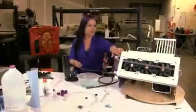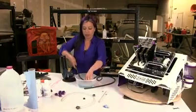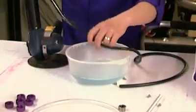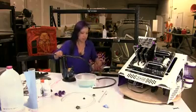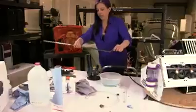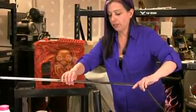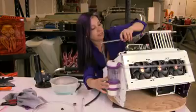The project is pretty intense because the case — it's a case by Primochill and it's actually a prototype. I really like the workbench style; I like having access to whatever I want to access. We've been hard at work on the tubing. This is a silicone piece that I'm dipping into some water with a little bit of soap, and this is going to keep the tube together when we turn on the heat so that it doesn't collapse into itself or bend. I'm just turning it in complete circles waiting for it to start bending. There's a tool down here on my right and that's what I'm going to use to form the right angle for this one.